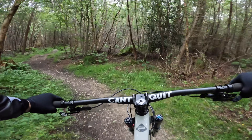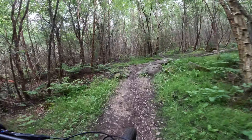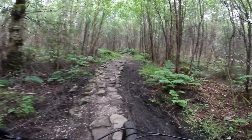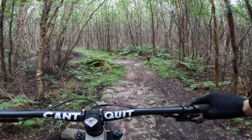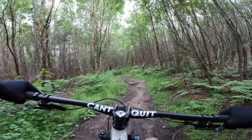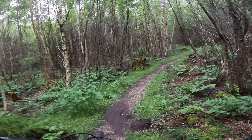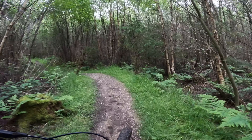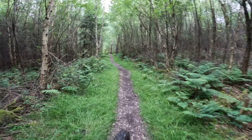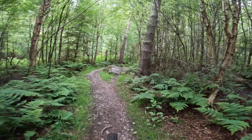I just need to check the progression on the front and rear — that's what I'm talking about. Pancaking off that seems to have put the little red rings where they were supposed to be, so I'll probably leave it like this. There was no reason not to — it's just always worth double-checking. I didn't feel any harshness through either end, so it looks like high speed is roughly where it needs to be. Happy days.